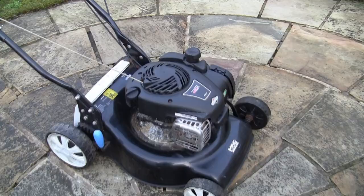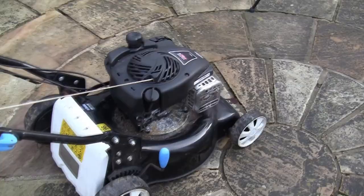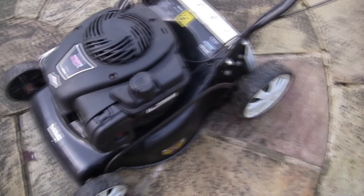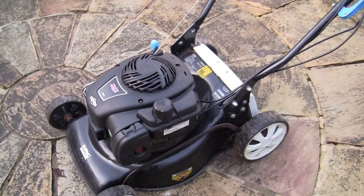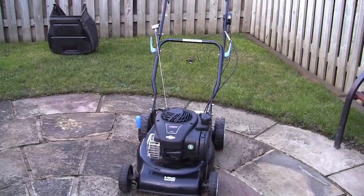Hi, welcome back to Repairing Lawnmowers for Profit. I thought I'd do a quick video just to let people know how I am. I've had quite a lot of requests asking if I'm still okay. I've got a lawnmower to do for myself - I'm not going to be regularly uploading again but I thought I'd turn the camera on. We'll have a look around this McAllister, paid £30 for it, I'm going to keep this one. It's got a drive on it. These newer style carbs are quite prone for pulsing, so if you've got one that revs up and down stay tuned. I'll probably strip this down and show you how to service the carb, and there's a few other things with these carbs that can go wrong.